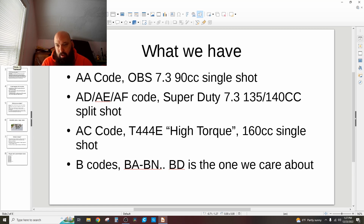The other engines that use the Huey-style injectors use B codes — BA through BN. Most of those are similar to the A code with different specs. The BD is the magic one if you really want big injectors. All of this is just stock part stuff, but there are guys out there with 300cc, 200% nozzles — that's all custom machined. I'm talking in this video about things you can make by just buying the right parts or mixing the right injectors.